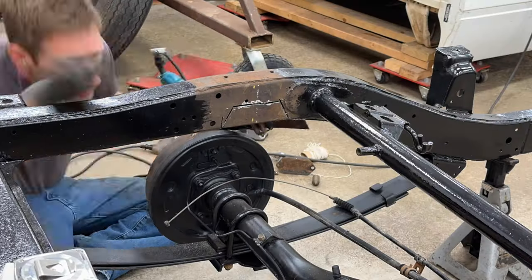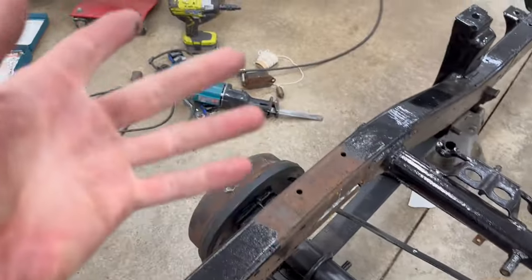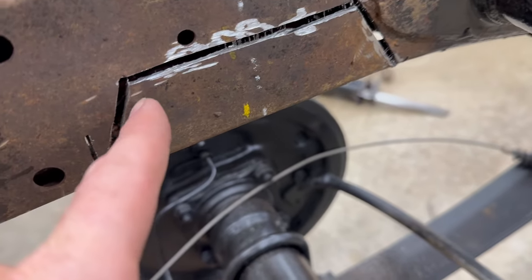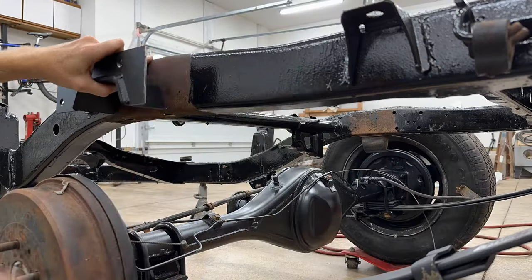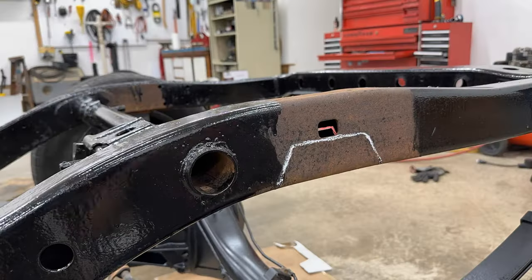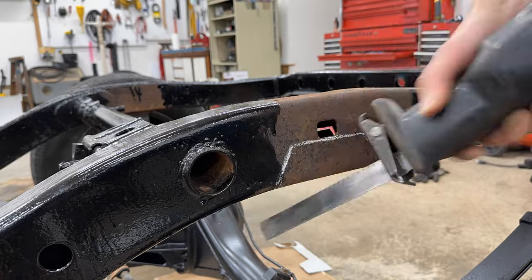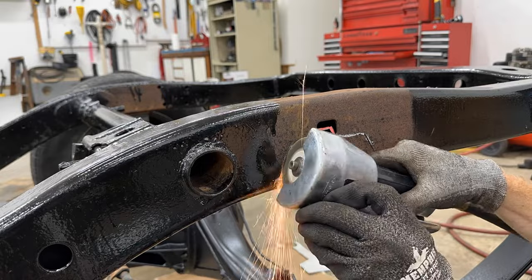Oops! I didn't realize I was coming up so far on the inside of the frame. The sawzall definitely saved some time, but you did see me screw up on camera there — I was just not paying attention to where the other side of the blade was. I thought I was in the groove the whole time and it turns out I was cutting a new one. Then I used the two lines on the bottom of the frame as a guide to line up the notch on the outside of the frame. I was more careful with the sawzall this time, but I got to an area that seemed a lot thicker and was not cutting easily, so I went back to the cutoff wheel.